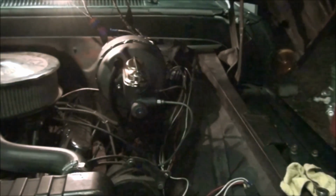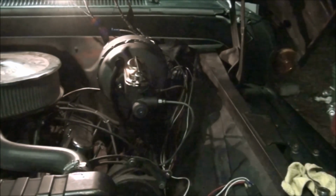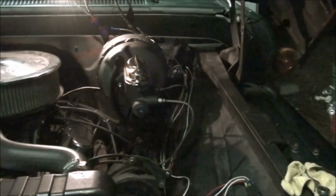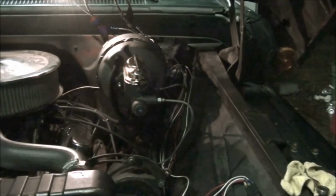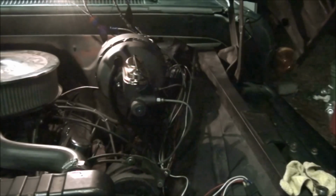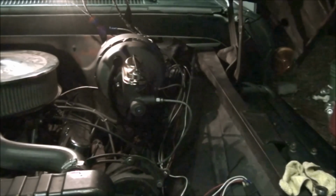Well, okay. I failed to show you what I did there. Just too blasted messy. But anyway, what I actually did was make sure my lines are in the right place. And if I didn't say it before, this truck had a single master cylinder. It was converted to a dual. That is how the lines got confused and mixed up. But they are both 1/4-inch lines, so you know it can and will happen. But like I said, I told you how to fix them right.